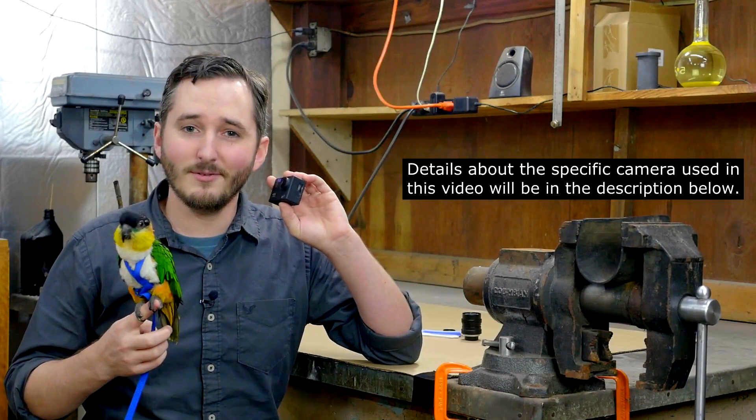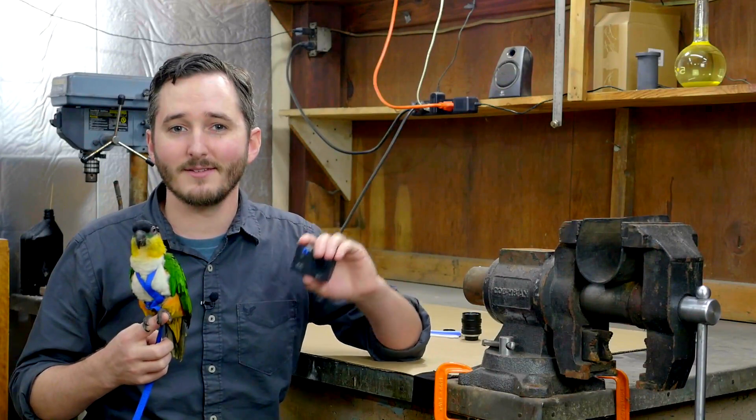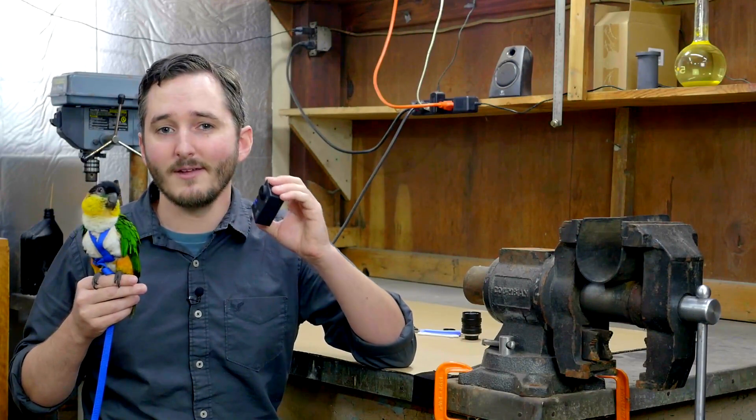Now, I don't want to use these as-is because they're equipped with, as I'm sure you're aware, a wide-angle lens. You'll recognize the wide-angle footage from an action cam from all the GoPro shots that have been around for years. By equipping this camera with C-mount lenses, I'll have a lot of other options for lenses with longer focal lengths, so I can get a narrow field of view, maybe even some macro photography.